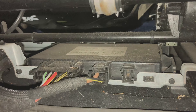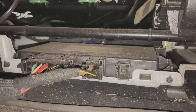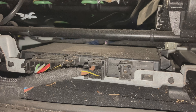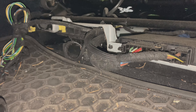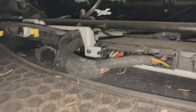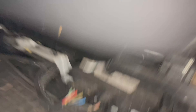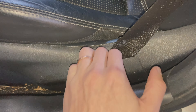The seat belt is unplugged — I might have to plug those back in so I can move the seat forward to get to the seat belt. This module controls the motor function, so this is the one I'm probably going to have to keep. The other one I'm guessing is maybe seat belt and heating controls — not entirely sure, you'll have to do some research online. At least I've got access now — just pop this clip off.